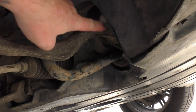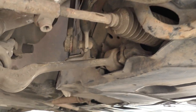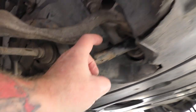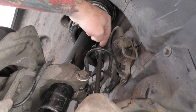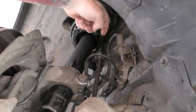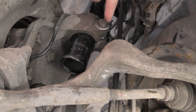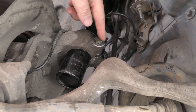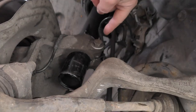Belly pan off. That one there - the nuts back here somewhere, 19 mil, 18 mil - this one here, that bit there and that bit there. You get a bolt and the nut off. That one hasn't got a nut on it. The drop link up here - you can get it out, but again you've got compression to pull it down to get out afterwards. Come with all the leads here, this bit here - and you can see it's new. That is a bitch to get out, both sides. I haven't got the strength - the impact gun didn't work. Eventually get it out.